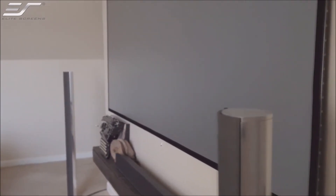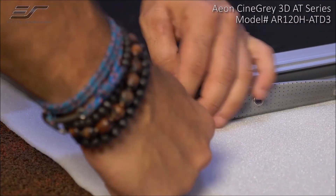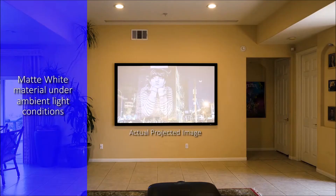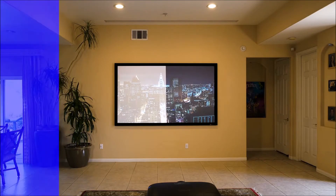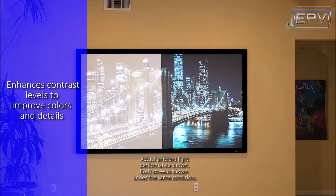Screen texture depends on the features you need. If you're using a 4K projector, you want the screen material to be perfectly smooth with very little texture or grit, since imperfections might affect the image depending on how close you're sitting. If you plan on putting speakers behind your screen, you want an acoustically transparent screen that allows sound to pass through the material — this is what's used in movie theaters. And if your room has a lot of ambient light, you might benefit from an ambient light rejecting, or ALR, screen. ALR screens work great for rooms with overhead lights since they can reject light from above while reflecting the projector's light back to the viewer.